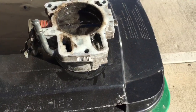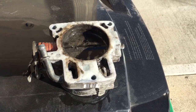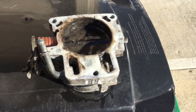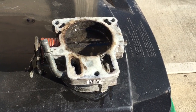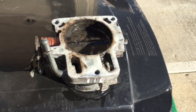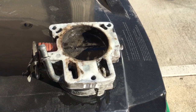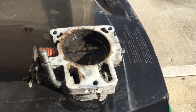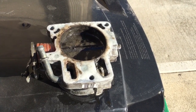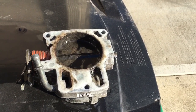I did a little bit of initial measuring, because these are advertised as a 75mm throttle body — it's not even that big. I will measure it again now that I've got all this carbon and burnt oil off. Last night the best I could get was a little over 74mm. You're not going to make a world-beater throttle body out of a 74.5 or 74.4mm throttle body.